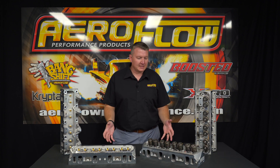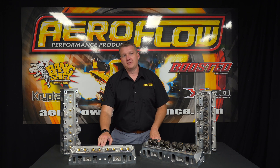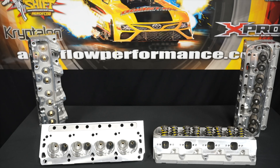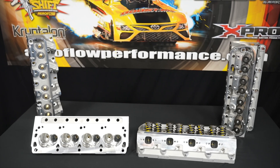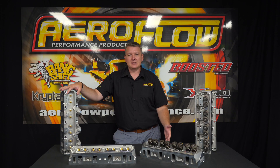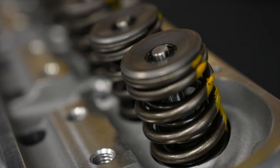We've touched on this previously when it comes to cylinder heads — alloy cylinder heads are excellent, not just for the performance from a horsepower figure for your engine, but also because you're going to wipe a bunch of pounds off the front end of your motor. When you consider some of these engines like the small block or the FE, when they come out of the factory, you're talking cast iron heads, cast iron intake manifold. When you're changing to an alloy head and an alloy intake manifold, easily you're going to be losing 10 to 15 kilos, or 20 to 25 pounds off the front end of your car, which not only is going to make it quicker, it's also going to make it handle better.